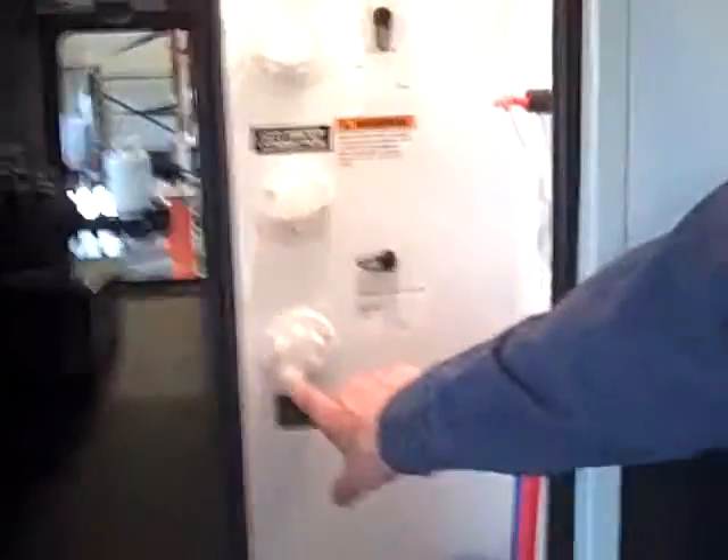The other valve down here is for a black water tank flush, so you can hook a garden hose right to it. What you do is flush out the inside of that holding tank. You can do that once in a while, especially when it's just sitting on a site, otherwise the tanks don't get too cleaned off.